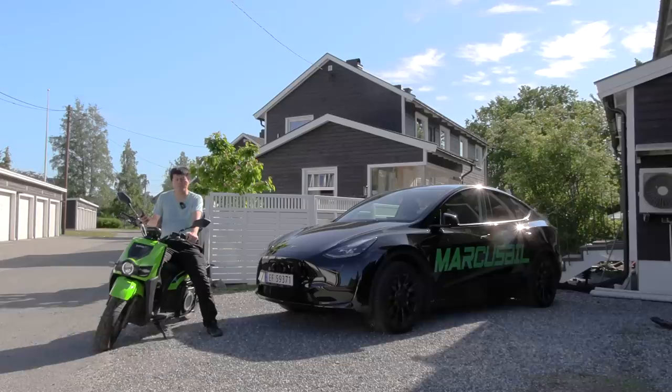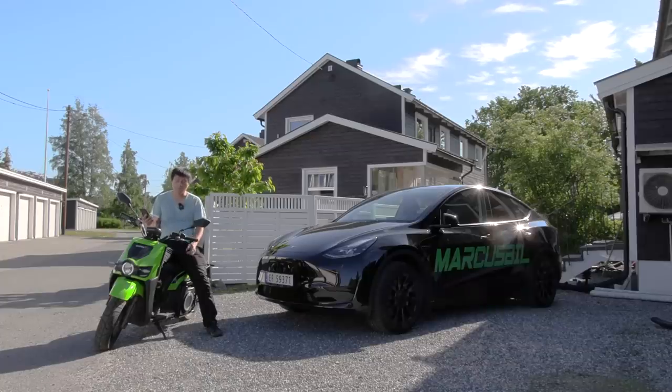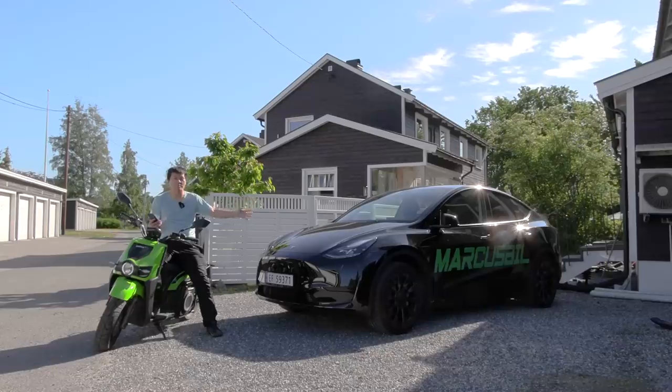Only 4.7 kilowatt hours — or around 4.4 kilowatt hours — were charged, which means there might be a somewhat massive buffer here, maybe around one kilowatt hour, to prevent the battery from being destroyed if you actually drive it to zero and leave it there. Just like a Tesla or any other EV, there's always a little zero buffer so that when you drive to zero you're not going to destroy the battery, and you don't even hurt it that much as long as you charge it right away — like I do on a zero-mile test.